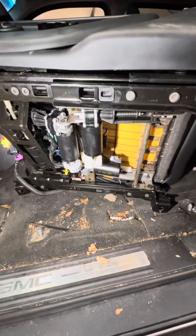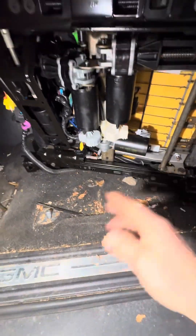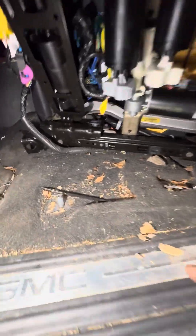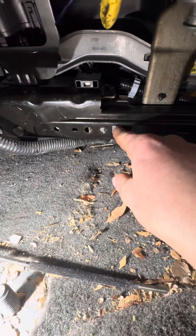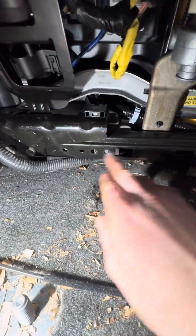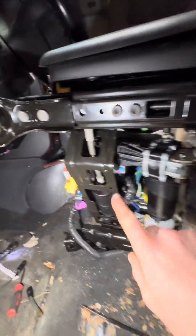What I'm going to do — these seats are ridiculous, it's a ton of work. This track slides. There are two bolts right here that hold this track to the rod and to that gearbox, which makes it fixed. I took those two bolts out so now this side will freely move, and then I hooked this side back up.